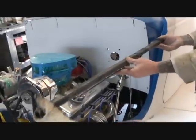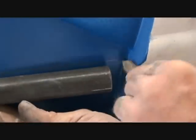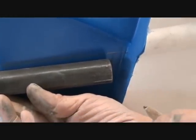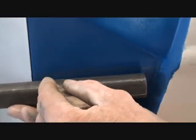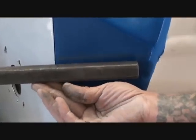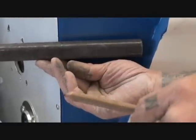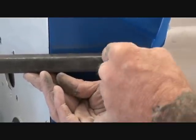We take our hood hardware just like this. Jeff, can you hold that over there? You're going to come back approximately — kind of eyeball how far you think that's going to fit in there. I go about approximately a half inch or so. I kind of eyeball it out; I've done a lot of these. You want to compensate for the thickness of that and drop it down. This is where we're going to bolt it. We only need one bolt in there — Street Beast says to put two, I put one — because of the way I support the front end, and I'm going to show you how to do that.